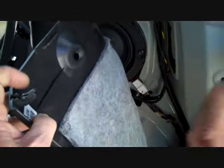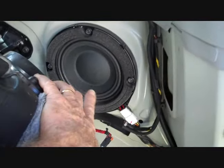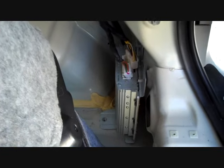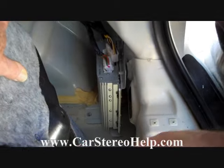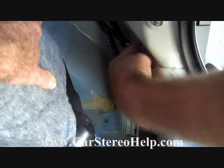That is going to allow you to pry along the edge of the panel and pull it back — the clips will all release along the edges. This gives you access to your subwoofer along with the amplifier located down here on the side along the rear of the vehicle. There are three screws: one 10-millimeter at the bottom, one at the top, and one on the opposite side.